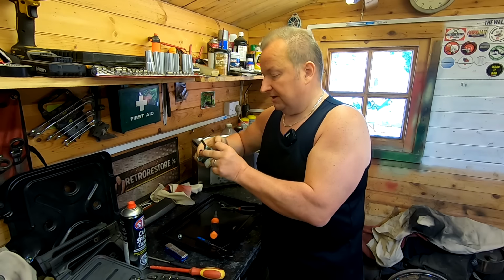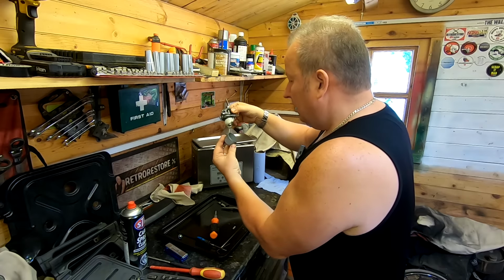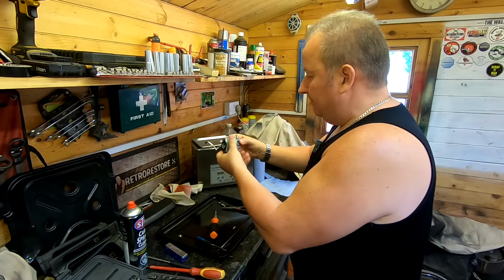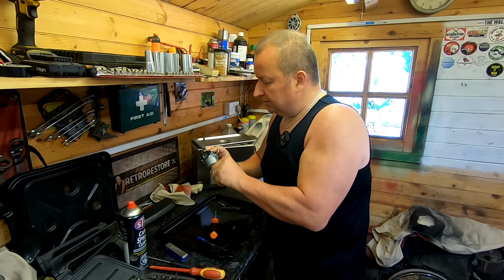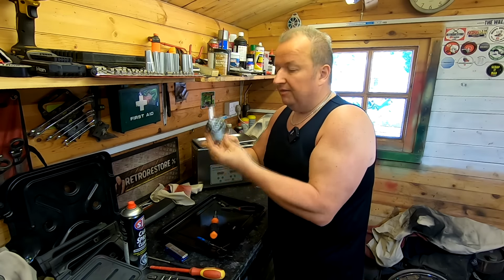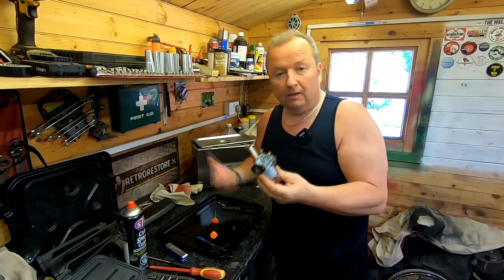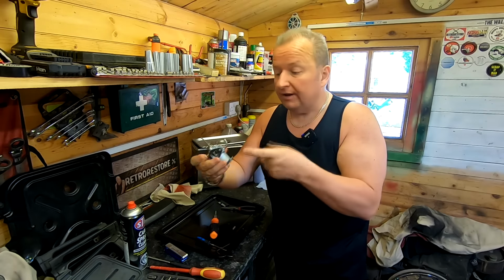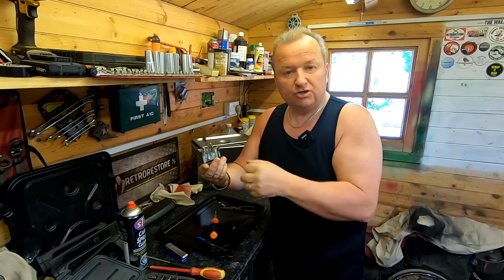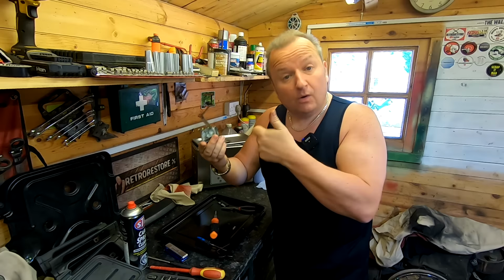The choke is the outer one. If I remember rightly what he said, that goes that way on there. And I'll just pinch that bolt up, knowing that everything on this carb is as best as we can do. Not over tightening it, as you can see. And that is our carb now fully rebuilt with the ultrasonic cleaner, with a drop of thinners in, and the airline to critically blow down after you've got the carb cleaned, to make sure that if there is any blockage in them internal fuel galleries, the airline would have pushed it through.